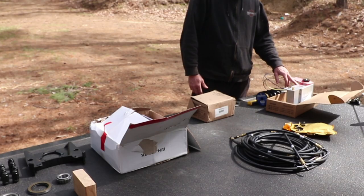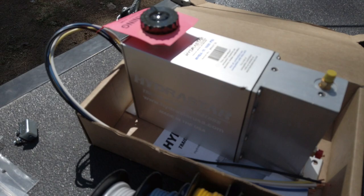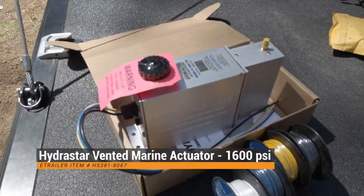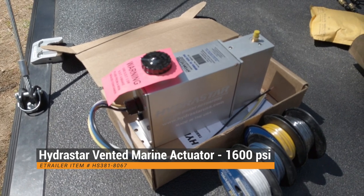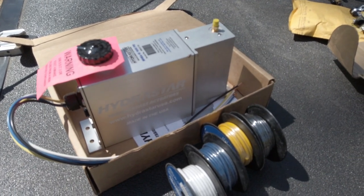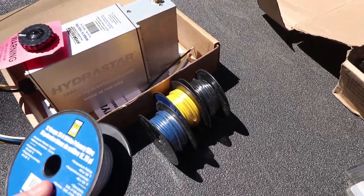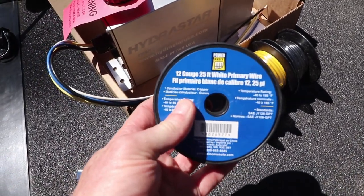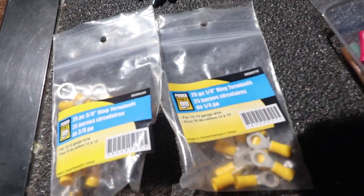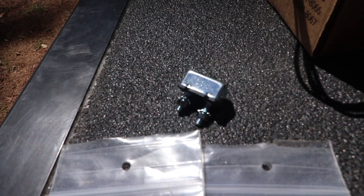I chose the MHBA 16 1600 psi pump, and that's plenty good enough for six brakes. We have a tri-axle here — if you have fewer axles then a lighter duty pump would be in order for you. I also had to purchase additional wire to connect this into the trailer, various connectors, and a 30 amp self-resetting circuit breaker as well.